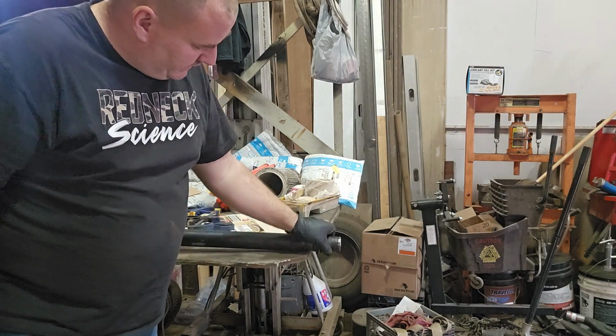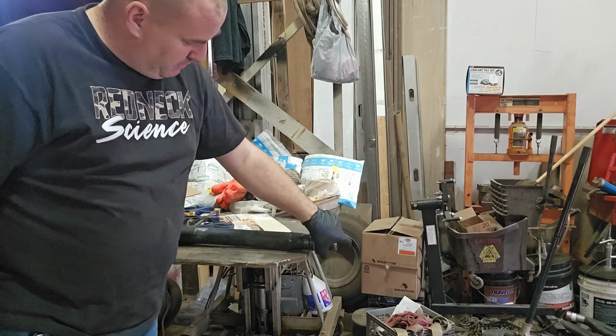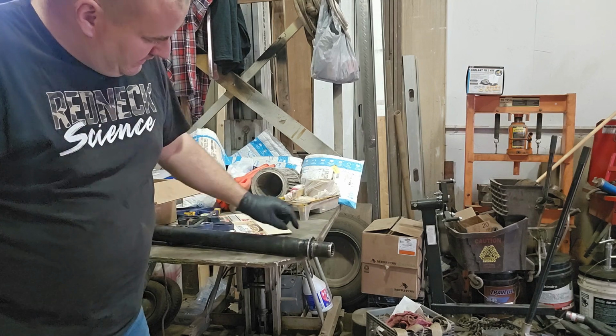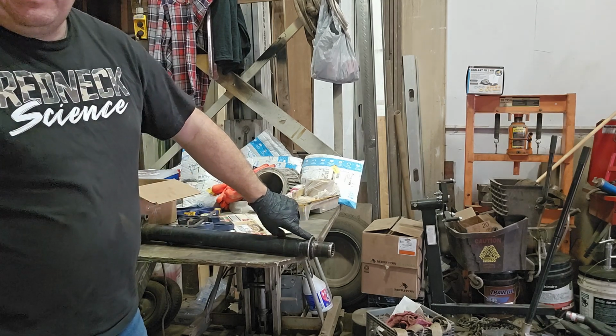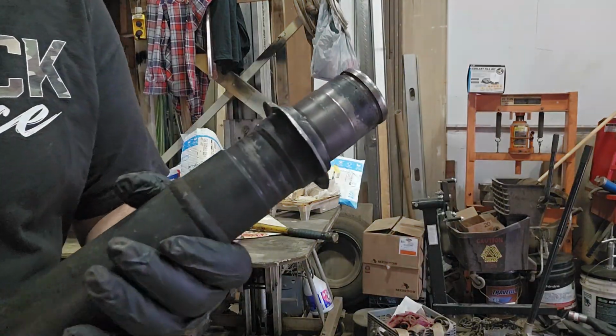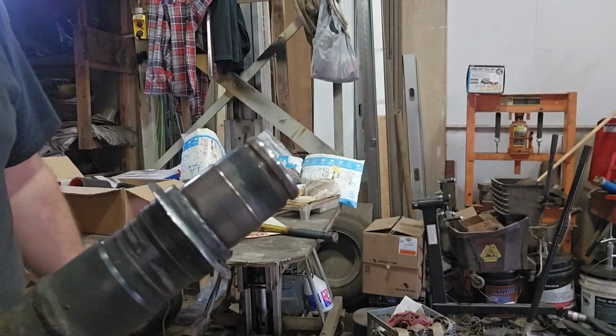Now, I didn't even hit the shaft at all. So it's clean. We're going to clean this with sandpaper anyway, make sure it's spotless, no grease, no rust. And this, I only dented it a little there. We can use a pair of pliers, straighten that right up. Off camera for 20 seconds. That's what I got on a benchtop wire wheel.